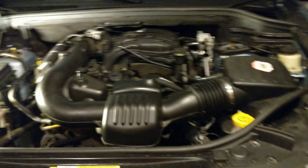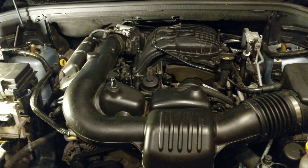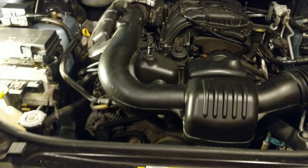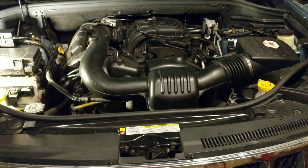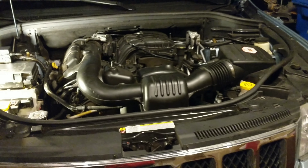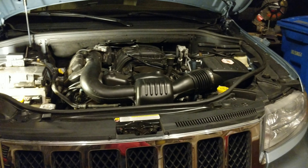After a little misadventure — getting my daughter to help me, her dropping a screw into the engine, me having to run out to the local auto parts store and luckily finding the exact size screw I needed — I got it back in, got the coolant all filled up, and got the new thermostat installed. Just need to tighten up the air intake bolts, put the hood down, and that's it. So if you get that P0128 error, all you have to do is replace the thermostat, just like I showed you here.